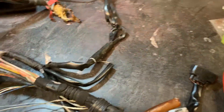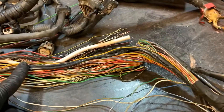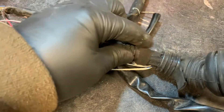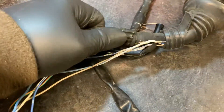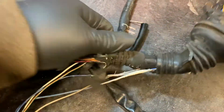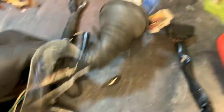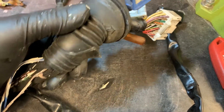Here are my three wires. It's pretty simple to strip the harness — just electrical tape around every so often, then wire loom, then taped again. The only tricky part is where the ECM is located in these Celicas — it's in a weatherproof box, and they put this stuff on the wires, almost like a plastic dip. It peels off okay, but it's a pain to get started. Once you get it started peeling though, it does pretty good. I don't want to destroy this boot — it's probably irreplaceable, so I'm not going to cut it.